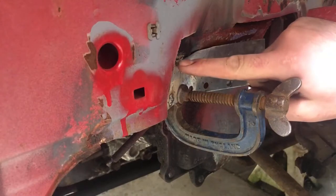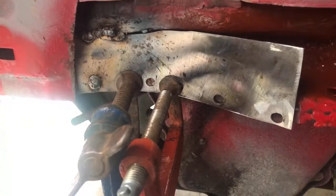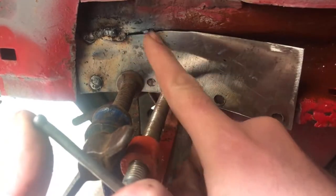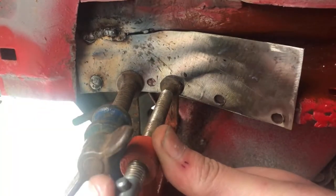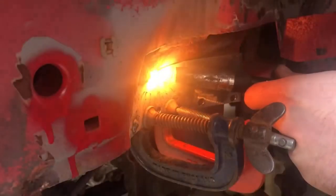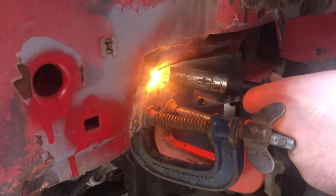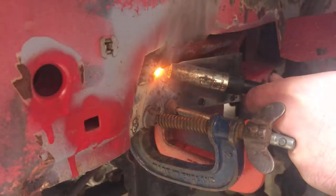With the top tack I can now go ahead and bend the rest of the sheet metal over, and now we can continue that weld all the way up until it's out of reach inside the leg. So with that pinned in there, go ahead and put another clamp on. I'm going to weld the top so it heats it up and I want it to take the shape as natural as possible, so we've got the heat going through it when I seam weld the top.